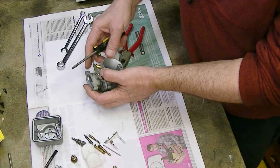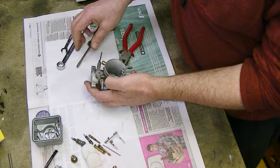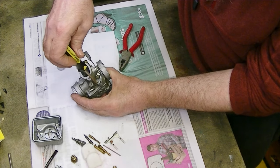I think I'll remove this choke plunger as well and then I've got it all stripped down. It's a bit of a fiddly mechanism this one. First thing is you've got to get this circlip off here without it flying across the room, and then undo this screw on the top here. If I wiggle the lever off, the whole plunger mechanism comes out. There's a little spring on there as well you just got to watch out for — that's the spring that works the lever. Right, so that's it all apart, ready to go in the cleaner.